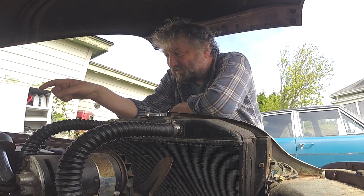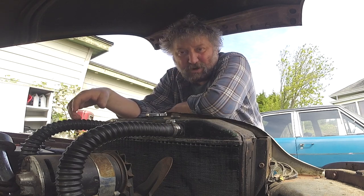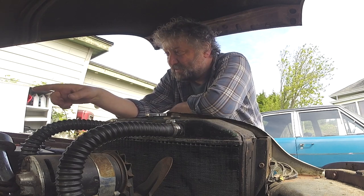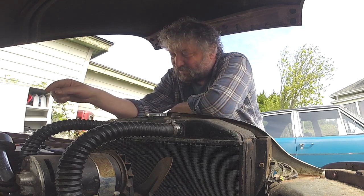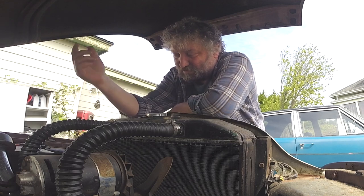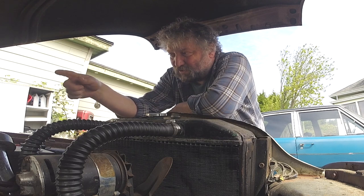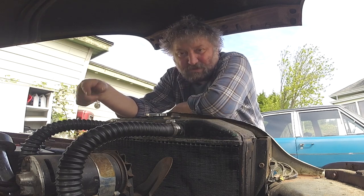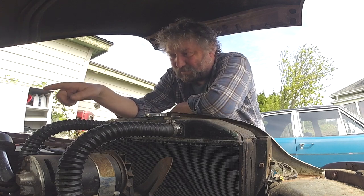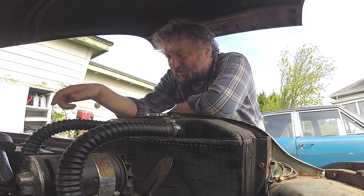So I think what I'm going to do is detach my priming bulb, and hook up to the fuel line that goes back to the tank. Pour some gas down until it hits the tank so that it's kind of a reverse prime, if you will, or priming the other side. And then hook all this back up, and hopefully once the car starts it'll have enough suction to get the fuel flow going. I'm also going to fill up the bowl by hand like I did last time with this bulb pump so that it will start.